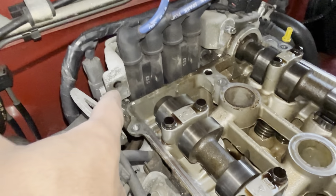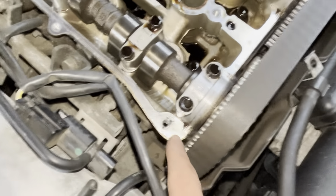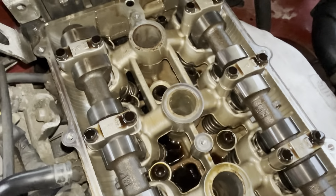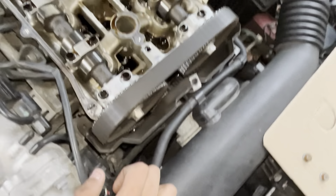There's going to be a 12mm bolt that's kind of hard to get to, so use a box-end wrench — use the ratcheting one if you have it. Now's a good time to clean the surface where the gasket sits and also clean the valve cover surface. This is also a good time to check your timing belt. This motor only has about 70,000 miles on it and it's looking good. One important tip: don't use a metal scraper — it'll damage the sealing surface. Use a plastic scraper and be very careful not to scratch anything or it won't seal right.